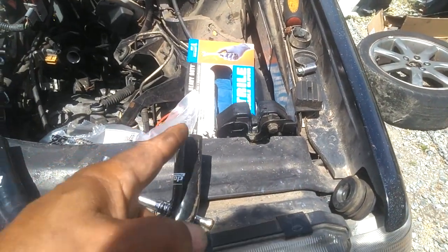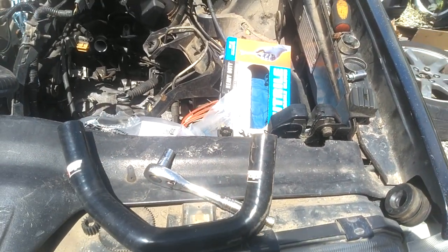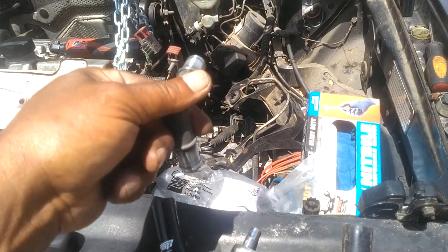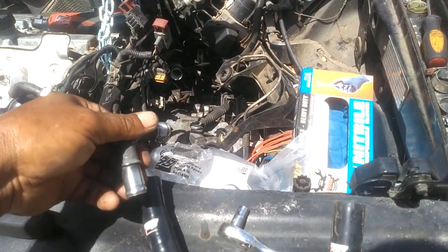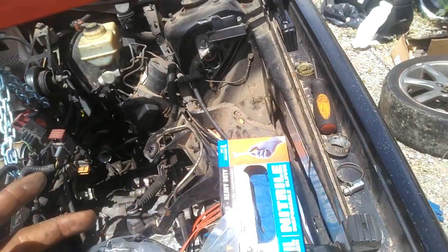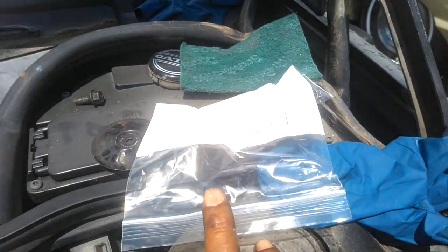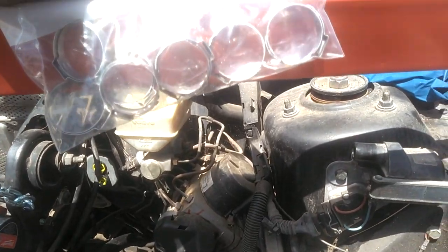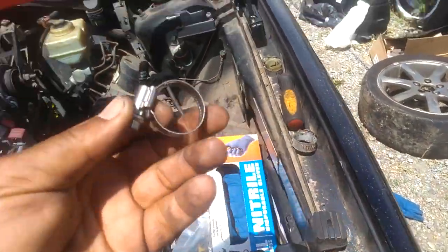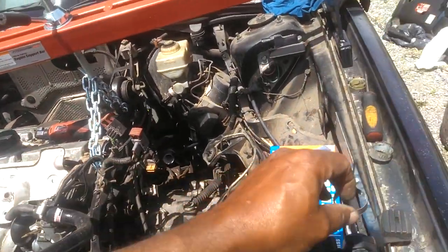The lower hose has the sharp bend — the sharp bend is the part of the hose that goes on the crossover pipe, and the slight bend goes up to this connection here. The smooth part of the connection goes into the firewall junction, and the part with the catch on it goes in the hose where you can clamp it. On all of the Volvo coolant hoses they have worm clamps, so I didn't want to use any other type. I found some worm clamps off of a coolant reservoir and I'm going to use those to hold these ends on these pipes.